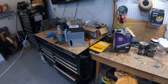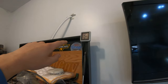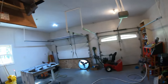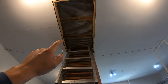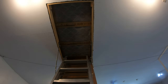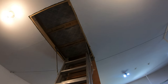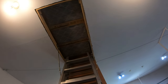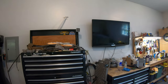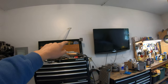I just want to show you guys the booth setup. I have a hose coming out of the wall, and my humidity and temperature gauge right here — it is 70 degrees in here. Up top I have spray booth filters, basically furnace filters from Home Depot, all put into a piece of plywood and sealed at the top. I'm pulling air from the attic, which is nice and warm because the sun's baking on the roof.